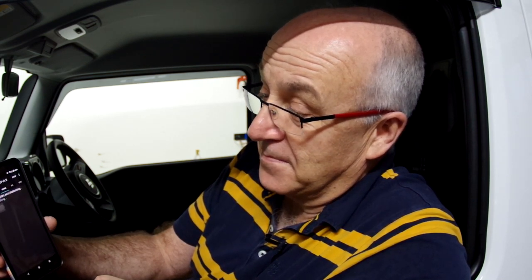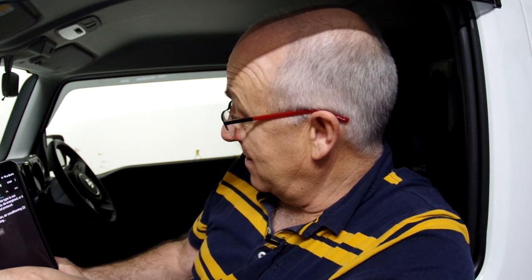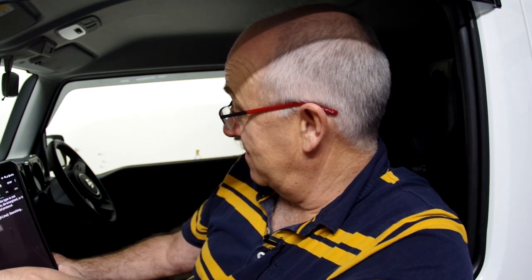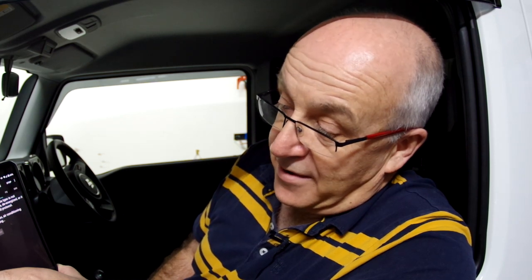And then we have the air conditioning, which this one has got, but it is saying it can't see it. Now, whether that's because it doesn't, let me just play with the air conditioning a minute. Turn it on. See if it sees it now. No. So this diagnostic system can't actually interrogate the air conditioning on this particular car.